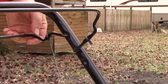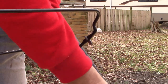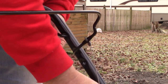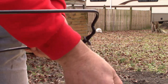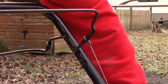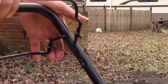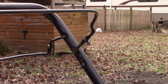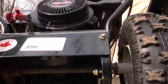That auger cable was working fine, but what I notice on the drive wheels is the cable has pulled out and isn't retracting all the way. I need to see why that cable is stuck — might have to open it up underneath and check that out. We do have the new plastic piece put on and that feels pretty good; one cable is working as it should, and the other is still stuck in the out position.